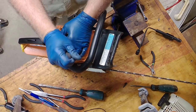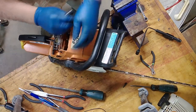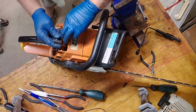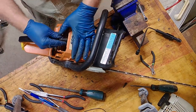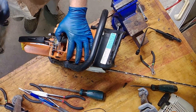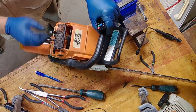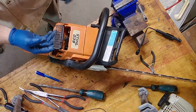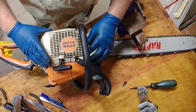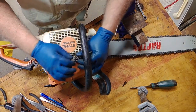Just snug — you don't need to strip anything. Just snug, real snug. Then we'll put our spark plug wire on it and put everything back together. We'll just put this back like it was — this goes over your air cleaner. I'm going to put the pull start right back on. Put this bad boy on first — it seems to make life easier if you do.